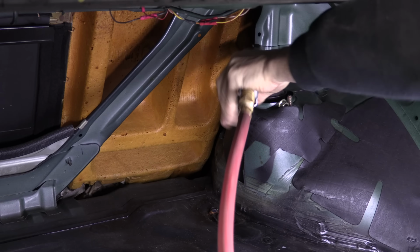Next, I rolled it over and took the strut and the brake lines off in the wrong order. I guess I was wrong in my previous sentence about the order of things, but hey, I fixed that. Moved on to the steering knuckles. Beat those loose. Removed both brake assemblies. Next, took the lower control arm nuts off, and I'd show you separating the joint, but I've moved right on to cutting the sway bar link off of the passenger side. Sorry, memory card. The lower ball joint let go, no problem, but I can't say that about this end link.